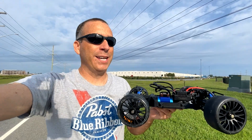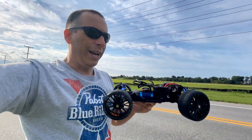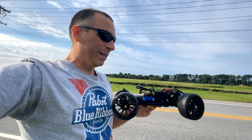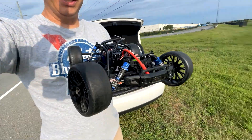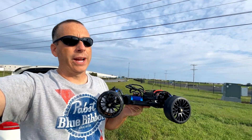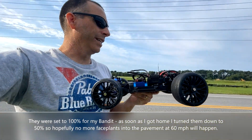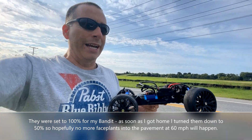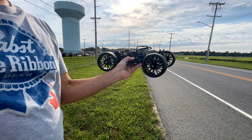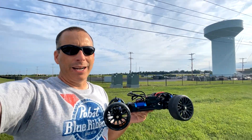68 miles an hour — I'll definitely take it, but I'm going to put an asterisk next to that. I like to do back-to-back runs and make sure it's a real reading. It is a new GPS as well, and I haven't had a chance to feel it out. So maybe it was 68, maybe not. But that was faster than I expected. I'll throw a new CVD joint in here and get it out next weekend when I have more time. I forgot just how strong these brakes are on 4S — I hit them a little too hard. When I get home, I need to remember to reduce the braking force on the ESC using the programming card. But that's all I have for now. 68 miles an hour, maybe. And this thing was an absolute ripper. A huge thank you to Britt for sending me that motor mount, allowing me to run a 19-tooth pinion gear that definitely helped this truck pick up some speed. See you guys in the next one — take care.